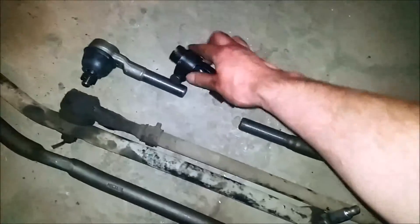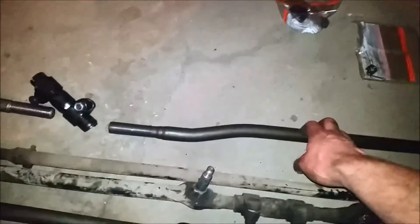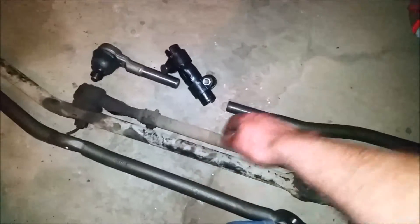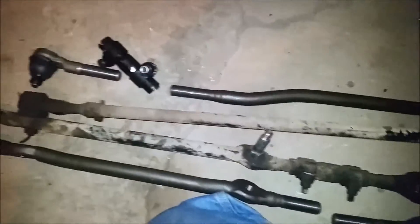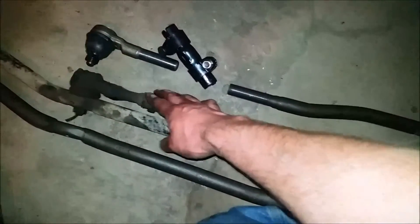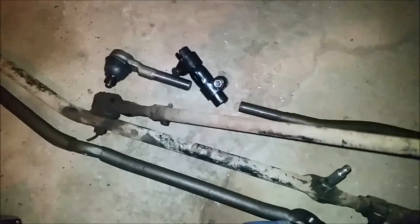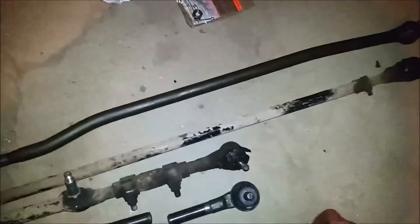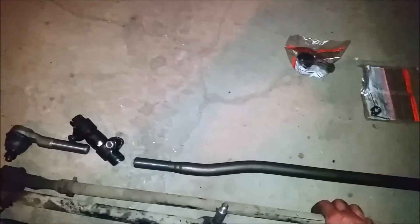I had to buy the adjustment sleeve of course because mine didn't have that. Now if you're watching this and you're not planning on doing this upgrade, you can reuse the old tube as long as it's straight and not bent. I did this on one of my other trucks a couple years ago and I made a little video on how to get these unstuck with a couple of pipe wrenches and a torch if you really need it - I'll put a link in the description. I gotta double check the orientation of this, make sure that's right. I could have it flipped, but otherwise I'm quite happy with it. Looks like it's gonna work out great.